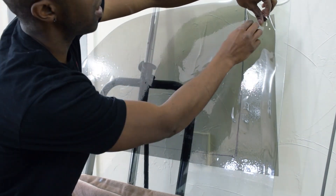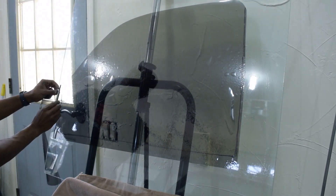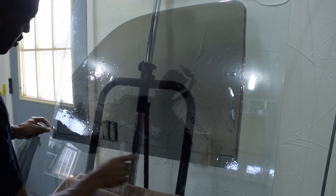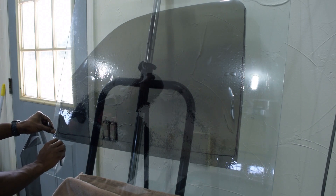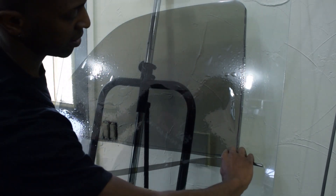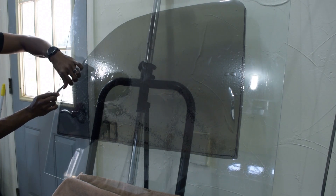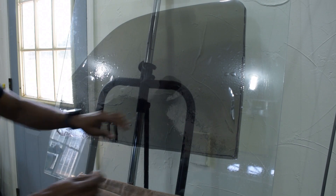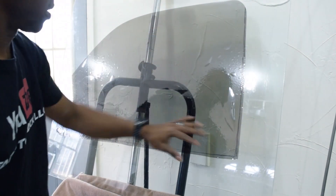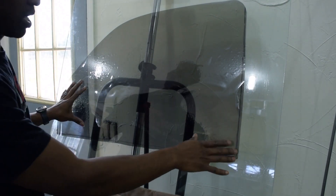So with this, knowing that it's a GM product, I'll probably go out about an eighth of an inch and trim right around there. I'll give a little bit more room because this can tuck back. Knowing that this is a Chevy, I will just go about a quarter of an inch lower. So this would be my pattern — I would raise it up, shrink it on the peel board, and then I'd be ready to go.